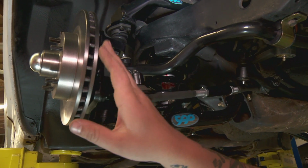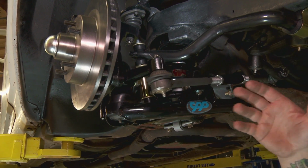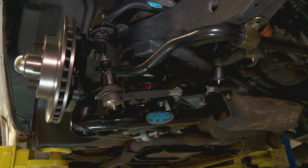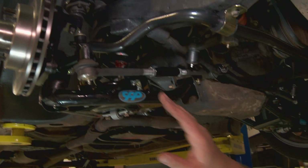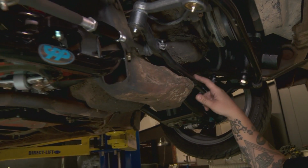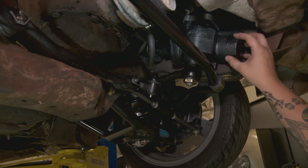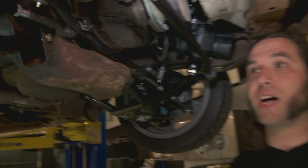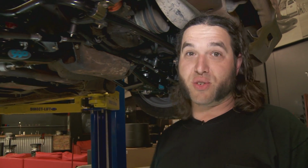We have 11-inch disc brakes that replace the old worn out drum brakes. We have a heavy-duty 1.1" sway bar for the front, as well as all new steering components: tie rod ends, this billet adjuster sleeve, center link, pitman arm, power steering box, even a rag joint. So the front suspension of this thing is all dialed, all new, ready to go, and should work well.